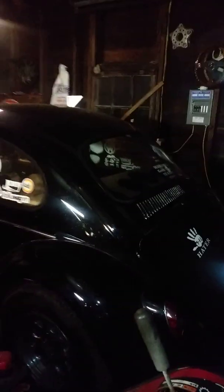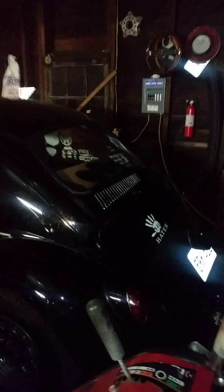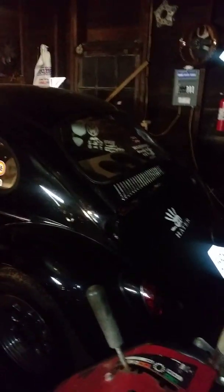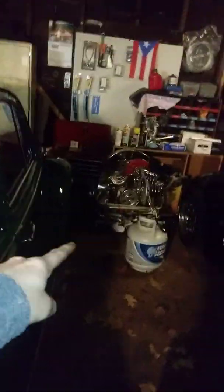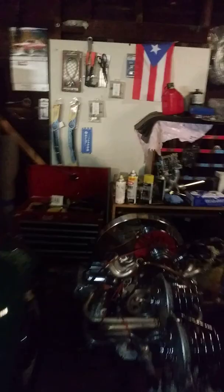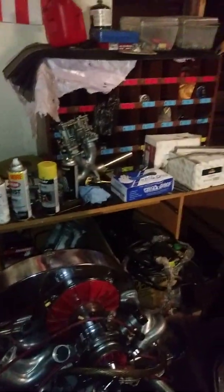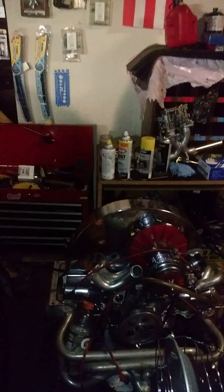This is a 1600 small valve engine — it runs pretty good. I've been trying to get fuel economy because lately my cars all swallow gas. This other one is getting about 18 MPG but it's an 1835 with a lot of modifications including combustion chamber work and a custom rocker arm assembly — it should make about 160 horsepower to the wheels naturally aspirated, and it's going to be turbocharged. And this 1776 I've had for about 10 years makes 140 horsepower to the wheels.